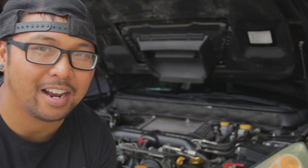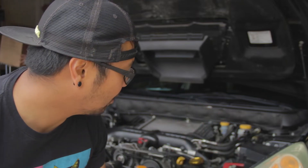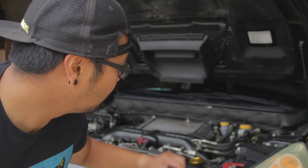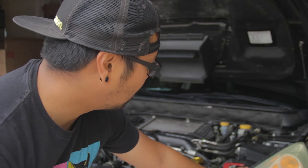Alright, what's up guys. Today I am doing a valve cover gasket replacement, as well as the little gaskets that sit inside where the spark plugs go — that's actually the portion that's leaking. One of them was leaking pretty bad and when I opened it up today the other one was actually leaking too, so we're going to do the driver's side on a 2010 Legacy GT.